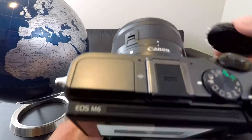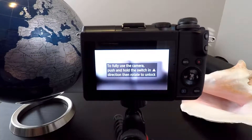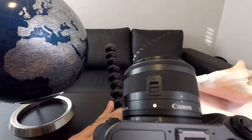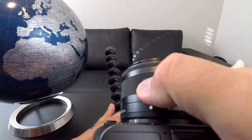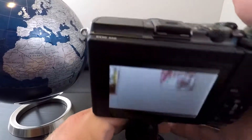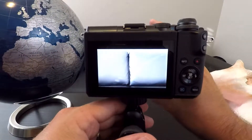So let's pull off the lens cap and have a look. You can see it is all blurry — you can't use the camera if you haven't done this step. It's really easy to do, but it's kind of confusing at first. You actually have to push this switch up here on the lens, give that a push, and then rotate to the left, and it'll actually unlock the lens. You can see that it is clear and you can zoom in and out.